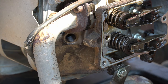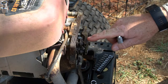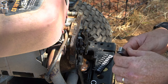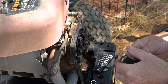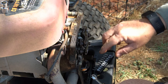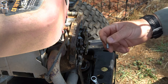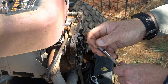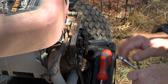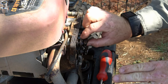Find top dead center and take it in just a little bit. Now we're going to adjust the valves. To adjust the valves you're going to need three things: a feeler gauge — this is a stainless steel one I got off Amazon, so it won't rust; a 10-millimeter box-end wrench; and a T20 star bit. You're going to need those three things. All these tools come out of my Crescent tool kit, except for the feeler gauge — I bought that separately.